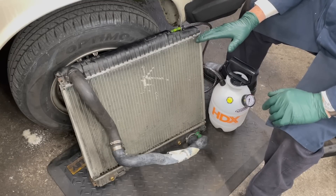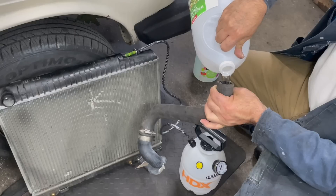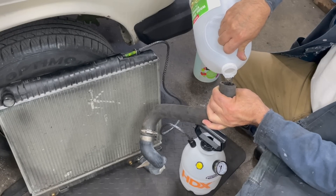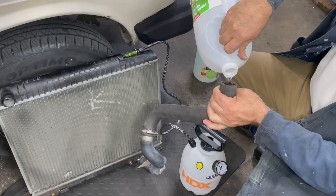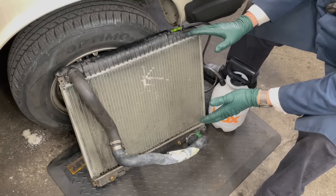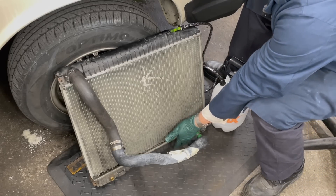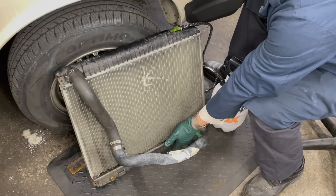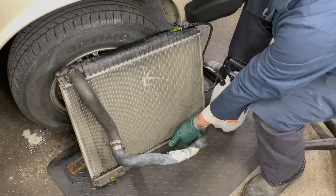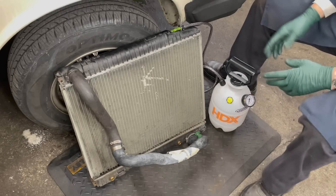We have a leak, but I'm not going to panic yet — I first have to make sure I don't have any small leaks at any of these connection points to the radiator. The best way to find out where the leak is, is to add some water — just put about a gallon of water in the radiator, pour it right through one of these hoses and hook it back up. Now, the pressure test I'm going to do is actually going to test two things: the radiator, and also the transmission cooler. If there's a leak between the transmission cooler and the radiator, you're going to see water coming out of these connection points for those trans-cooler lines. Let's see if we can find out whether I can save a buck here.